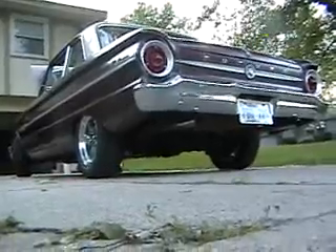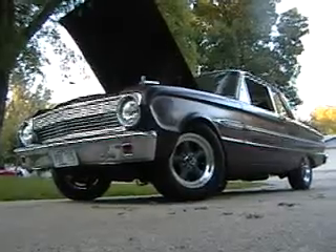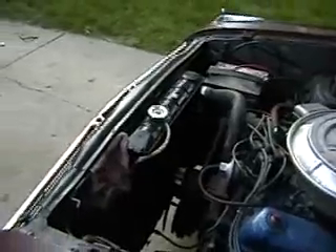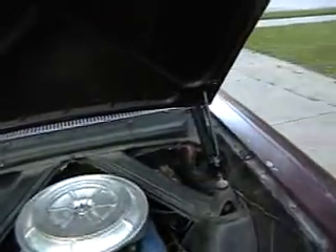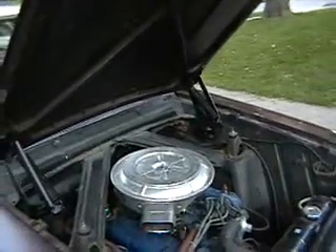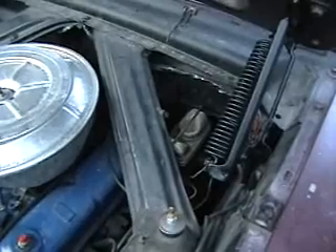There's a good bug's eye view from the rear, and there's a good bug's eye view from the front. The radiator came from Benson Radiator. The front spring hinges — which no, they did not have spring hinges in the '63 Falcons — came off of, I believe, a '64 Comet. A dual-bowl master cylinder, I believe, off of a '70 Maverick.